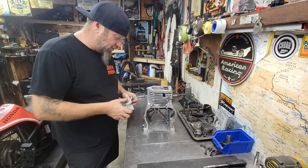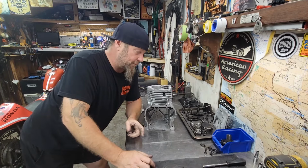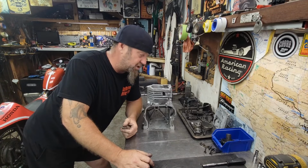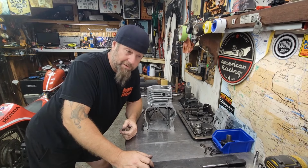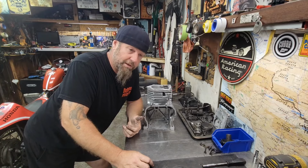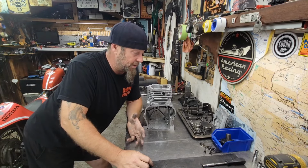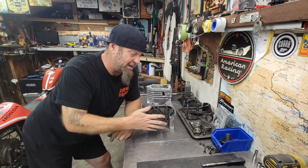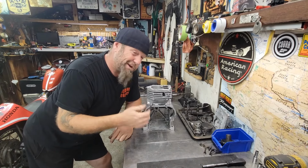The place that I've used to build these 5 horsepowers for years now is OMB. OMB Warehouse has pretty much everything you'll need for these things. Actually, everything for these and then everything else, small engine-wise, Predator, Briggs. It's a long list now because they have a lot of stuff. But they have everything I'm going to need for this build. They have the rod, the side cover, the flywheel with the different ignition pickups so I can advance the ignition and make more horsepower.